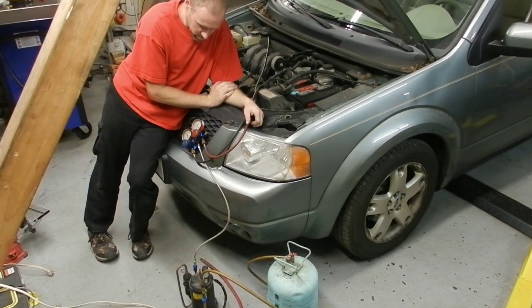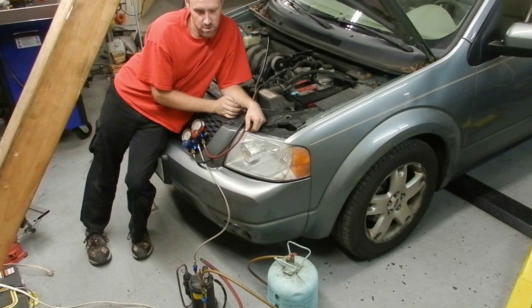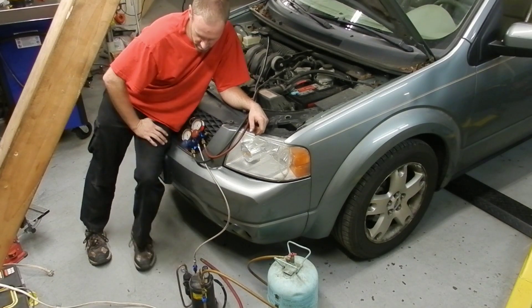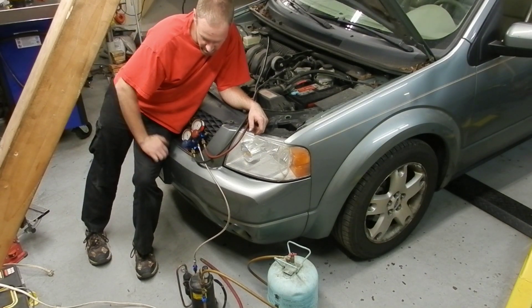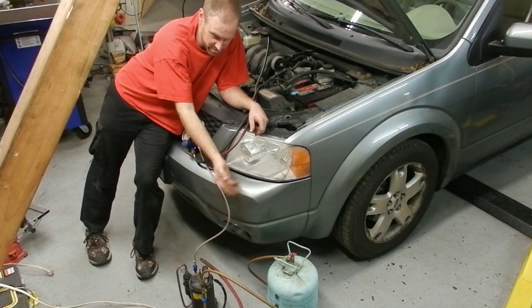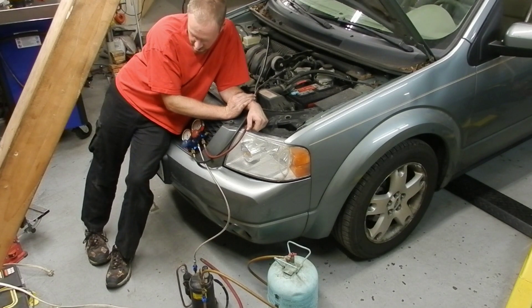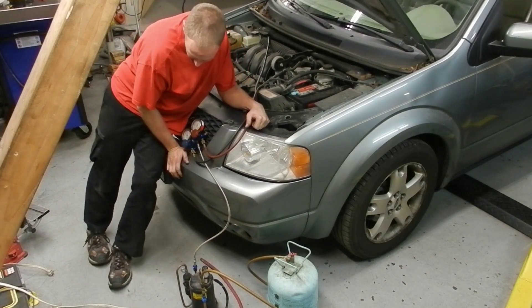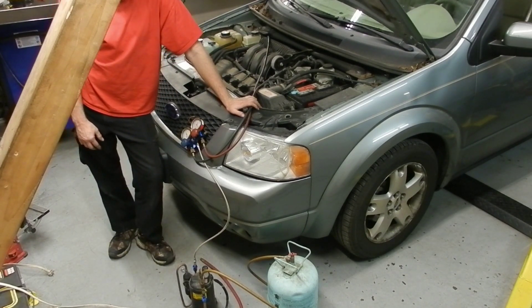I just created a pump system to evac out these cars. I haven't taken the financial decision to actually buy an AC system, but I took this fancy old compressor from a really old AC unit that happened to have sprung a leak anyway. The compressor was still good, so I adapted it to a couple of AN fittings and adapted those to other fittings to get it to work. It's kind of a conglomerate mess — I taped up some wires to make sure the pump fired. It's a temporary deal, but I'm going to see how it works. The pump did fire and run, so let's give it a shot.